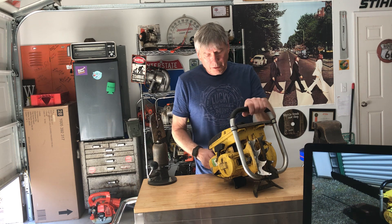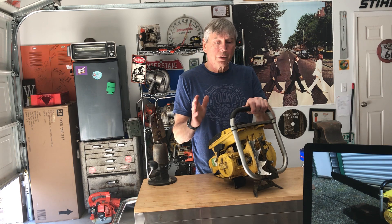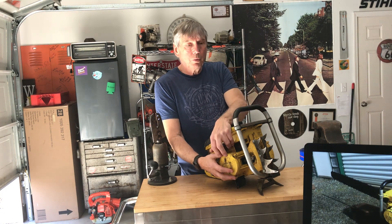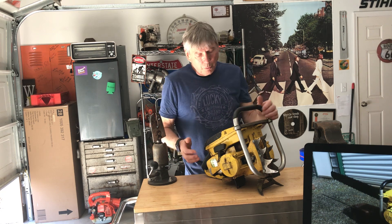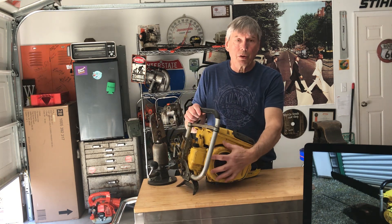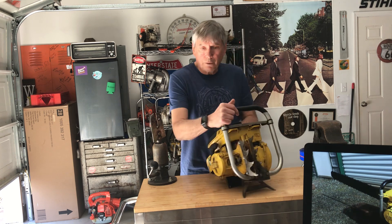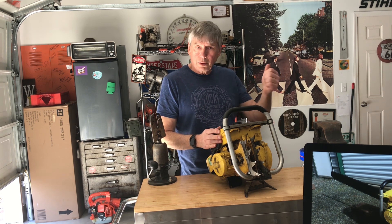This here is one of mine from my collection — runs like a dream. It's a McCullough 790. It's got the steel sleeve cylinder, just in perfect shape. It's got the right side starter. They had a lot of issues with these; they were easily worn out. The guys didn't line them up right properly when they were using them — all kinds of starter issues. What we would do is with the Super Pro 125, with just a slight modification, you could put a starter on the left side — a Super Pro 125 recoil starter — and either take this one off or leave it on. A lot of guys left it on because back in those days, guys did not come home when they had a broken starter rope. They just kept on going or they repaired it on the spot, on the stump.